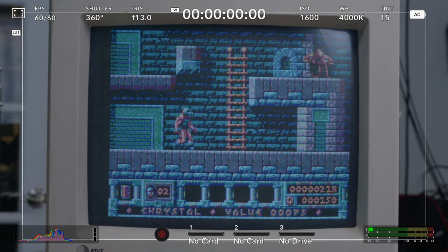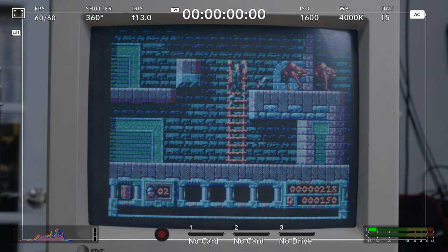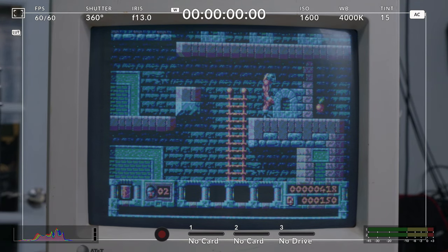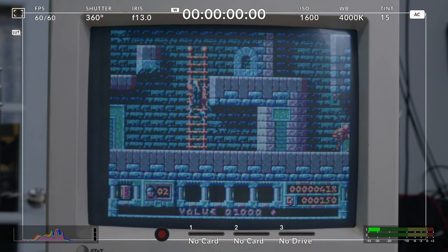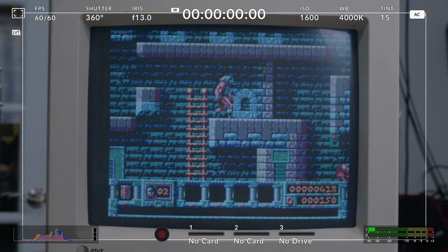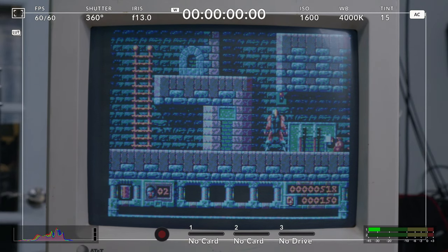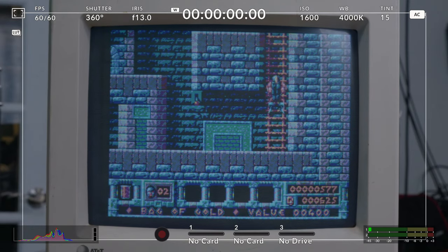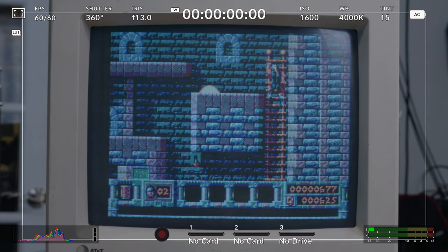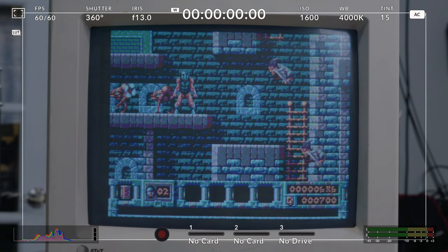This looks like VGA. This is unreal. I would never have believed you if you told me this was EGA. But see, the thing is, this nuanced color palette could have been used with games like Commander Keen, for instance, except that when VGA came out, it had to implement an emulation of EGA for backwards compatibility, which means that for all intents and purposes, VGA simulates an IBM EGA monitor complete with its assumptions about resolution and color. You can't fake it. I don't think so anyway.